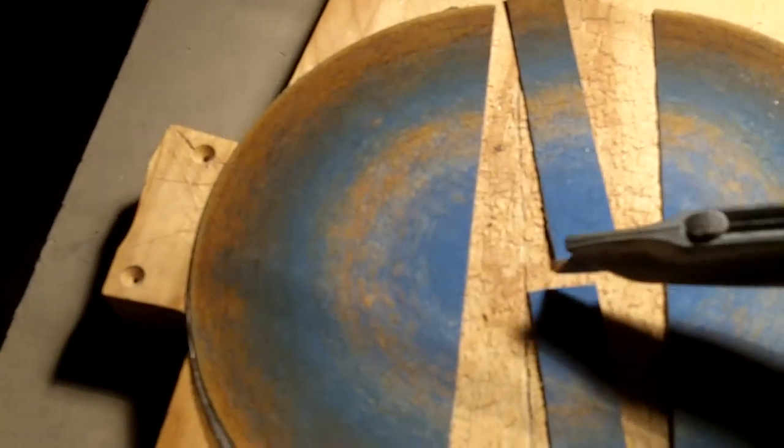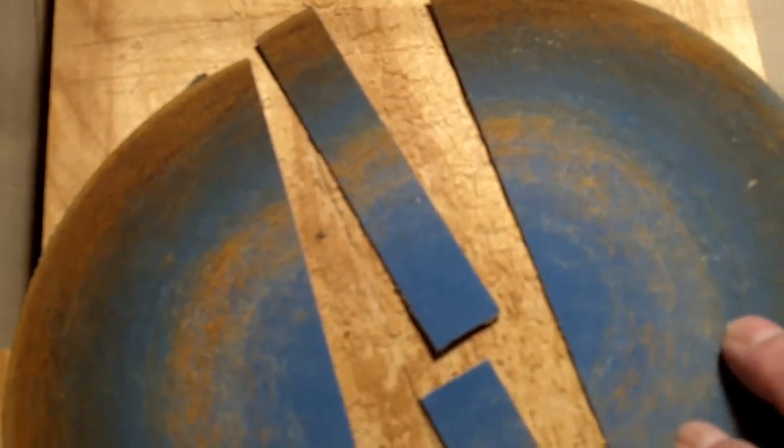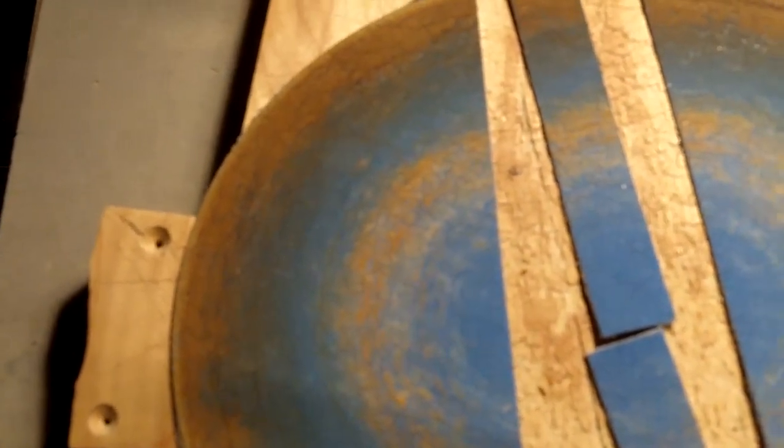They're about 1 inch wide, and I went ahead and cut through the middle because this area is going to have the most abrasive part of the grit, the zirconia grit. This is, or was, a 100-grit paper or fabric, and because it's been used a number of times, you can see out here that this has been used on plastics, phenolic plastics, so it's pretty gummy even though I've tried to clean it several times. So this is only used for metals at this time. Anyway, there's our feeler gauge.